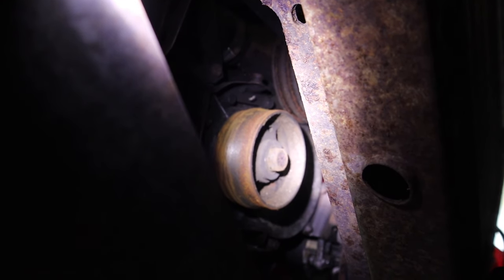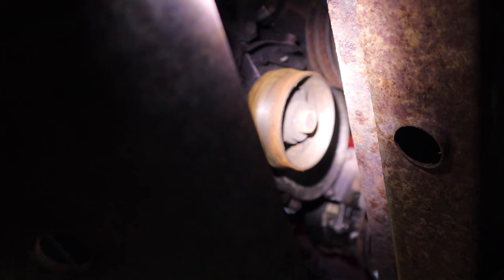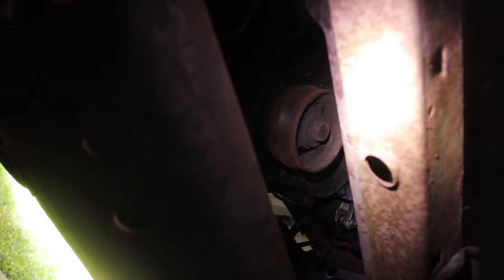What you are looking at is the remnants of that damper assembly on the front of the engine. The issue is you can't just put a ratchet on there and pull that bolt out, or an impact or anything, because there just isn't room. And the engine just turns, so it almost has to be an impact to take it out of there. I think what we need to do is pull the radiator and just lift it straight up enough that we can go right through the front right here with an extension and get on there and bust that bolt out of there. I think we can do that without unhooking everything. Let's give it a shot.